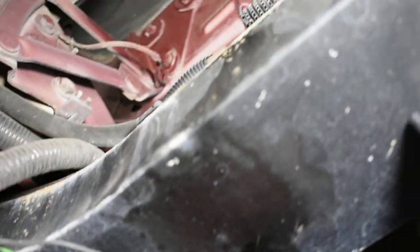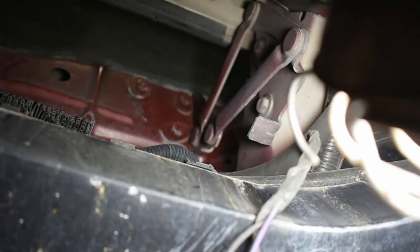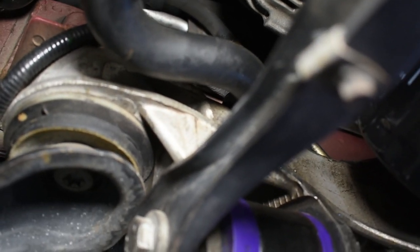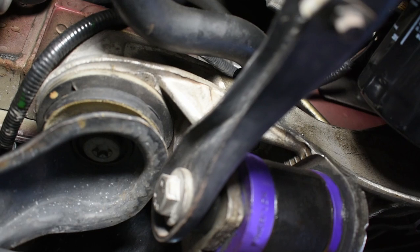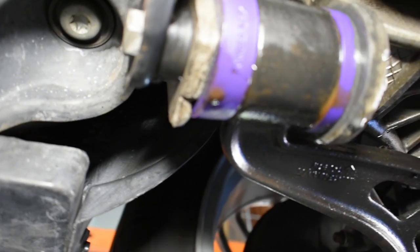This cooler pipe simply is just snapped in place. You can see that little snap right there — that's the snap that holds it in place, and you've got another one that's a little better visible right there. We're going to pop that cooler out, unsnap this side because it's already a mess, and see what oil we can get to come out before we start taking loose the other side to try to keep the other side cleaner. It's been kind of going across some of my bushings here, and the sway bar bushing as well is a little wet. We want to try to get those cleaned up and dried off as best as possible.